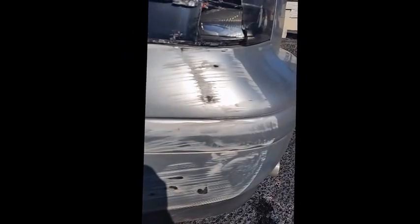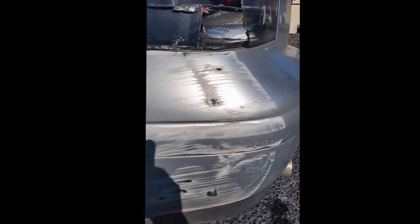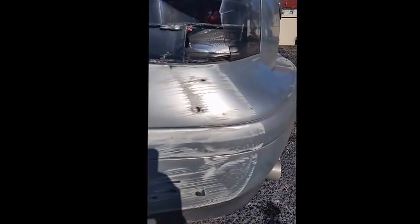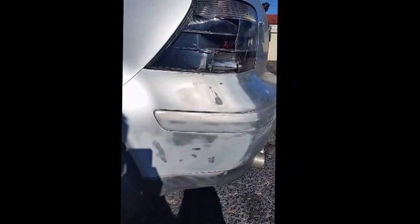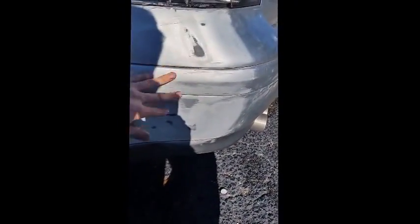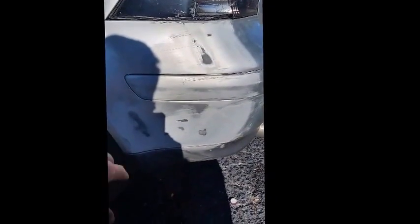I'm going to start today by doing some 400 grit sanding to homogenize the surface and prep it for priming tomorrow, which will actually fill in the holes — not the paint. One of the goals is to only sand the areas where you have the scratches; you don't want to damage the good paint. I've gone over the heavy areas with around 100 grit block and then 220 to smooth them out in a circular pattern, and done some 220 and 440 touch-up on the finer scratches.